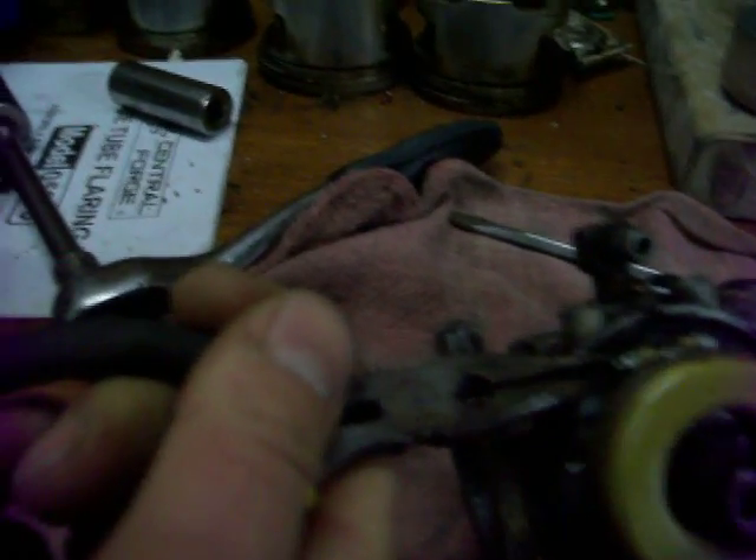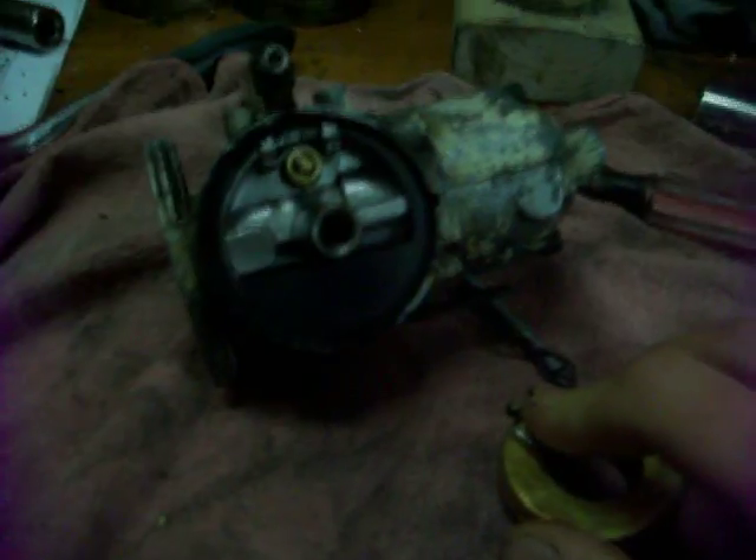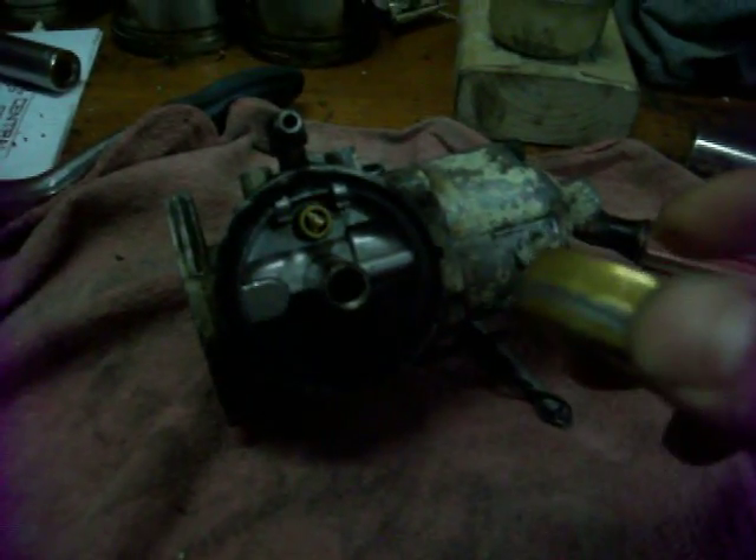You don't want to just push it down because you can actually wear out the needle. So I'm going to go ahead and take that off. All I've got to do is pull this pin out — and don't lose it. The bowl makes a great tray. Then you can pull the float off. Now, this float still works, it's fine. I'm going to go ahead and bend that just a little bit back because I can always bend it the other way later. That'll probably be good. I'll adjust it when I put it back together a little more.